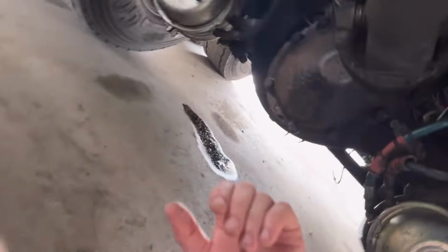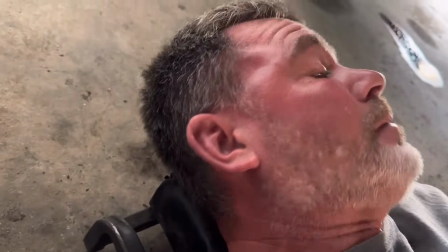All right, so we found an air leak again right there. That is the service line going to the valve that goes to the brake chambers, and it was leaking. I didn't hear it before. My buddy and I did an air test the other day, but he didn't want to get in my truck because he was so dirty. He stood on the ground and hit the brake pedal with his hand, and that's why I didn't hit it hard enough. This time I got in there and hit it hard, and I found it.